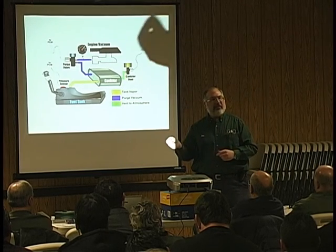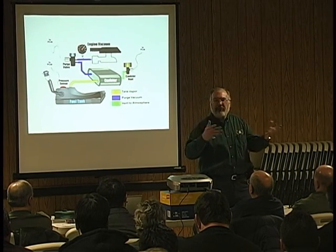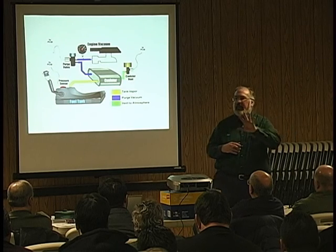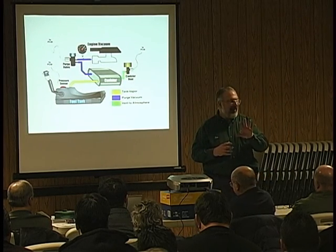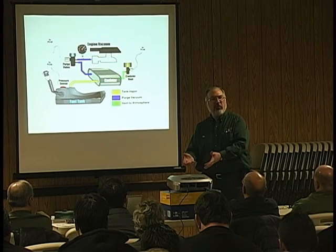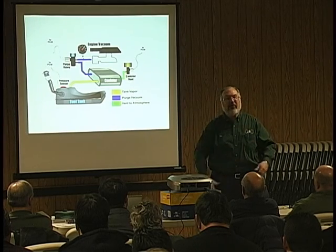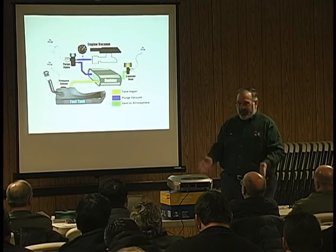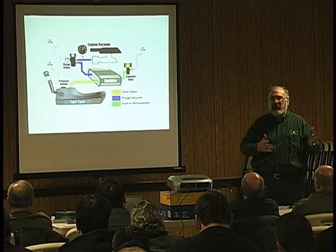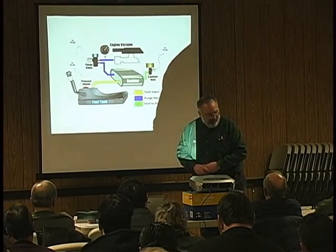So I talked to the owner afterwards. I said, you know, this doesn't have the right oil pan in it because the drain plug doesn't match. He says, I've been to the dealer 5 times for oil changes. Every single time I need a new drain plug. Every single time. So evidently the mechanic there went to the parts counter, got the one that the book calls for, and just stuck it in. It didn't fit, but he pushed it in anyway. So anyway, it just goes to show you, just because the book says something is the way it is, you gotta open up your eyes and look. At least we took a look and got the right drain plug in, and he won't have a problem ever again.